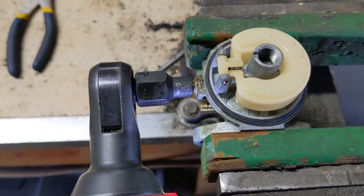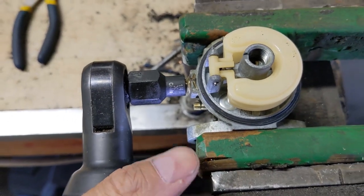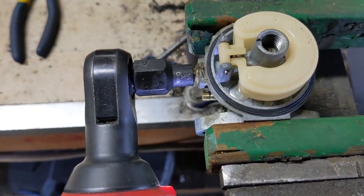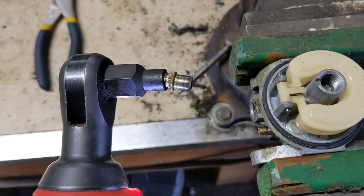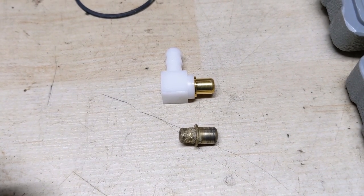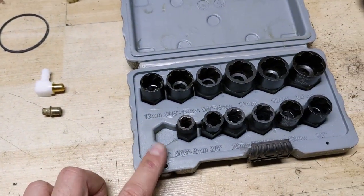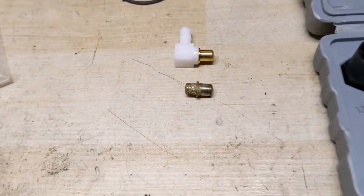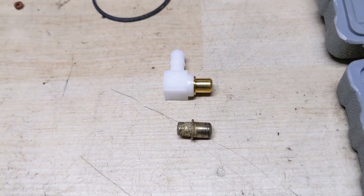However, it may still be a little difficult to pull out. So what I'm going to use is my Milwaukee cordless ratchet here. We're going to plug that in, get it to spin, and we're going to put ever so slightly an outward pressure on that. And just like that, we remove the brass insert. Using our quarter-inch bolt extractor, we were easily able to remove the brass insert for that fuel inlet.